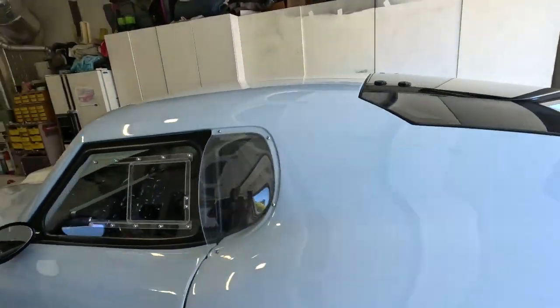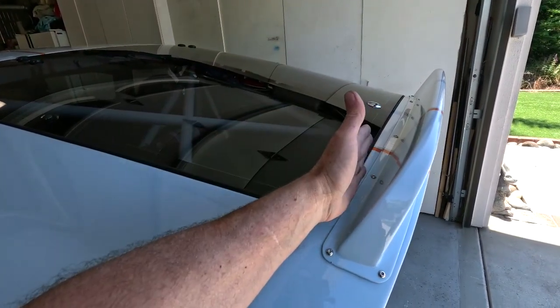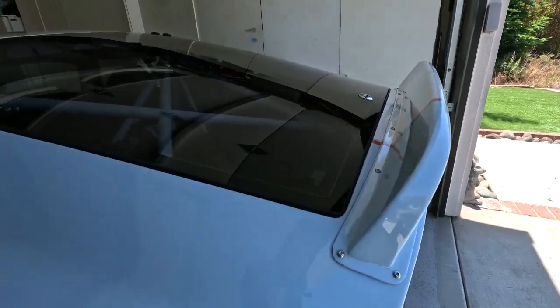When we did put the R-nose into the SolidWorks flow simulation, that is by far and away the best option if you want these cars to have really good aero — put the R-nose on and never look back. I'm trying not to change the look of the car though. As for the rear, the yarn test showed it's attached back there and you get a high-pressure zone driving the rear down, which is the point, but if you're really looking for a pure slippery shape that thing has to go.